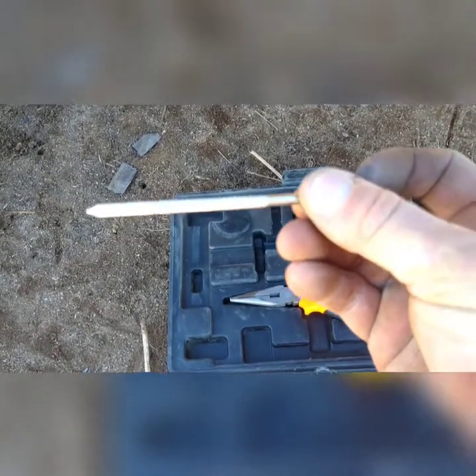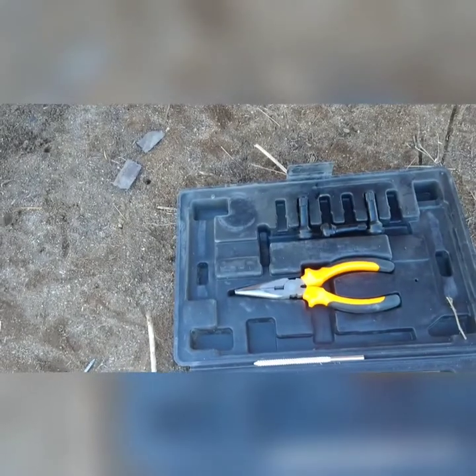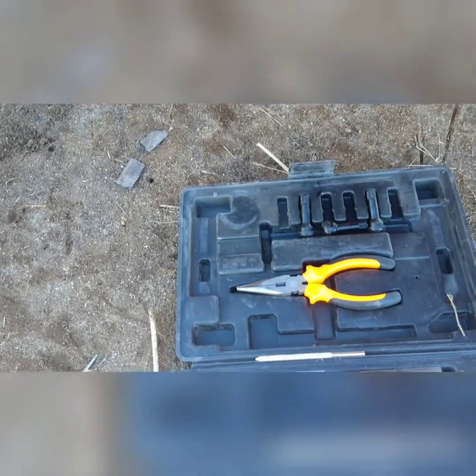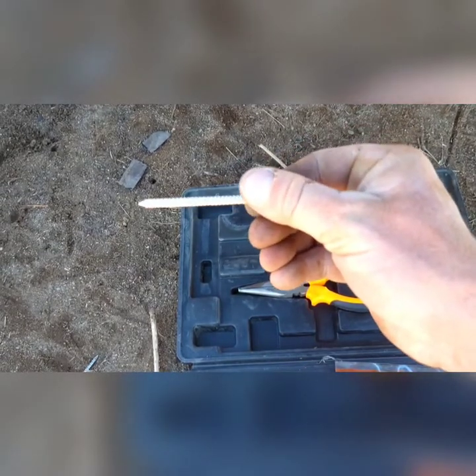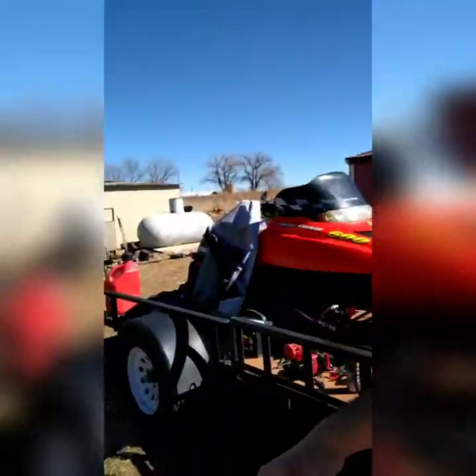There's also a backup reamer — this one's more of like a rasp, which may have worked better for what we were doing. The one we used was like a corkscrew kind of, but it got the job done. We did struggle a little bit, so maybe if you get this kit, start out with the rasp, because there are steel belted bands — basically a bunch of steel wires inside the tire that make it super strong — and you have to pierce through those. So yeah, if you like this video, give me a like and subscribe, and I'll keep putting out stuff. One other thing: for this tire repair, you have to dress like this.